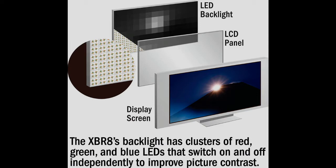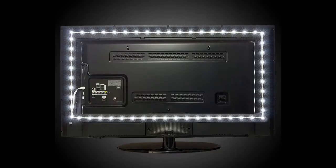It's not so much built-in obsolescence, but something that will increase the failure rate is the LED backlights. The LED backlights on a lot of sets are rated 3.7 volts, but they are driven at 5 volts, which gives a much brighter picture. With normal use — not 24 hours a day, 7 days a week — I would say those should last 4 to 5 years. After 4 to 5 years, those LEDs fail.